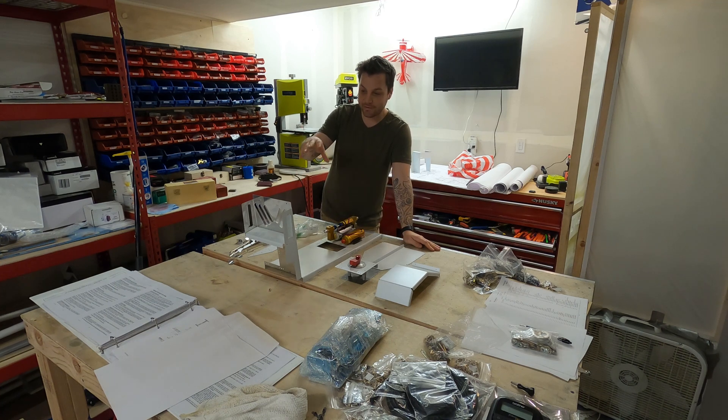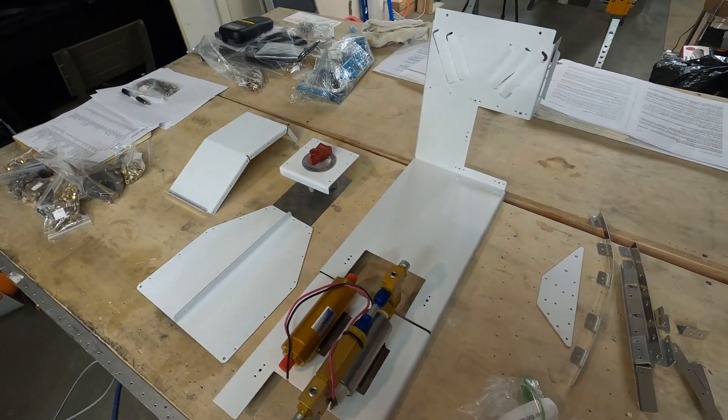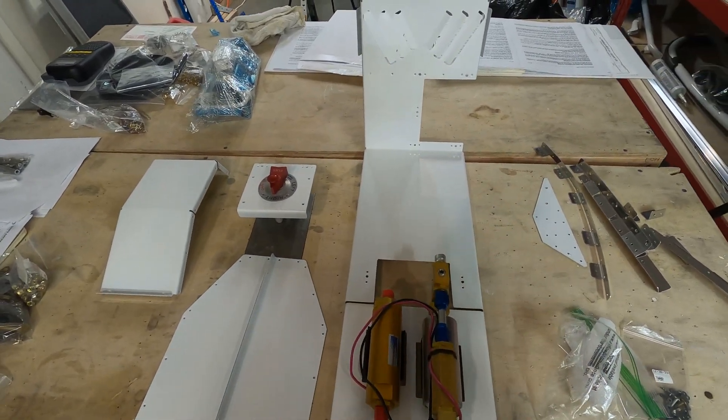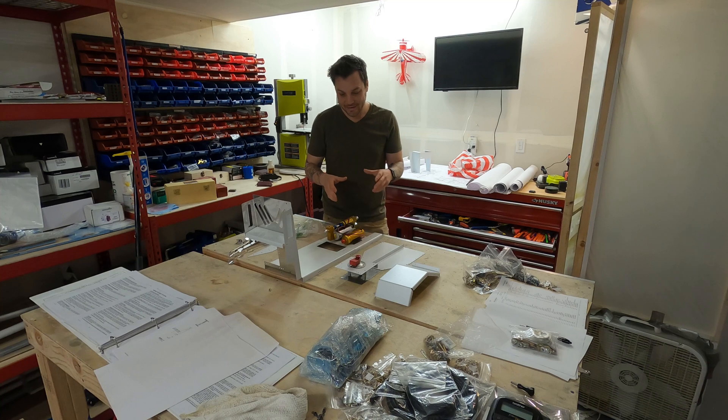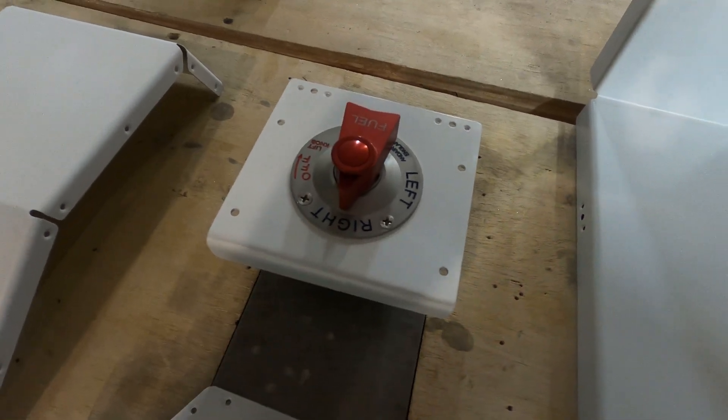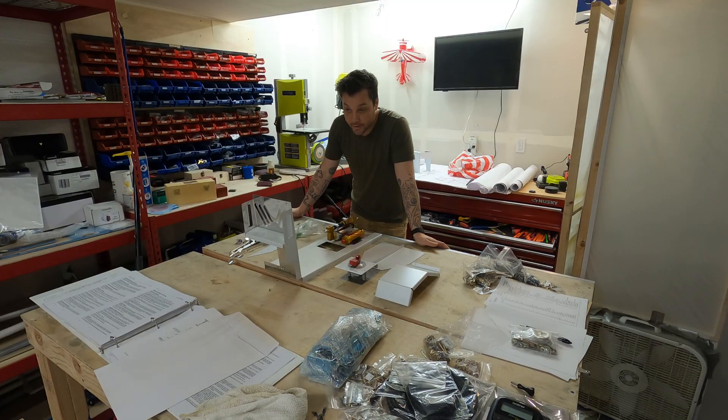I'm back. The primer on these parts came out looking fantastic — I'm really happy with how it came out. Even though these pieces will mostly be covered with carpet, they're still visible right in the middle of the cockpit. Now all I've got to do is start adding some nut plates so we can get all of this screwed back into the cockpit. There are a couple pieces that also need to be riveted together, so get the squeezer out and start squeezing away.